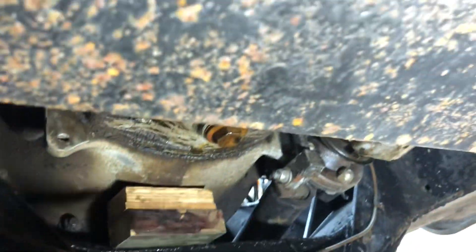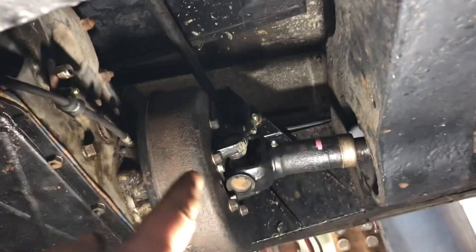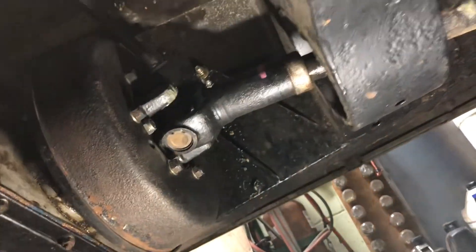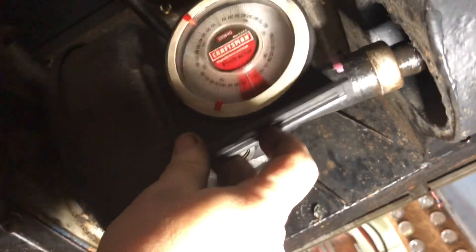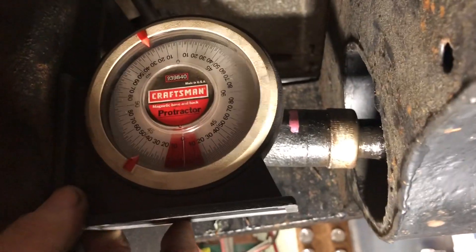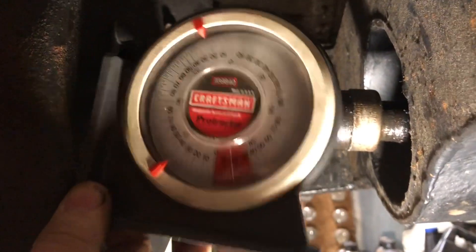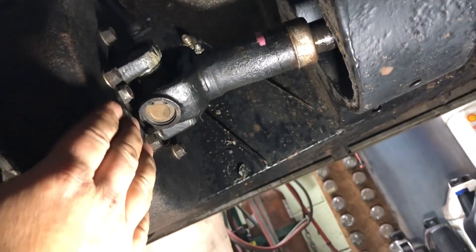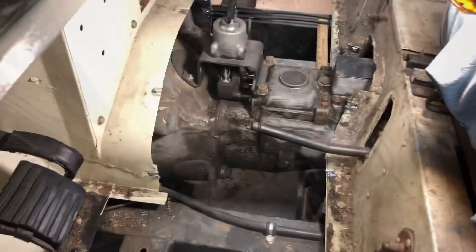Moving back here to the handbrake — I got the protractor back — when it hangs it's just about again almost half a degree toward this way, tilted a little bit. So we can get our engine in the proper position using the handbrake as a reference. That confirms the front measurement — we're at about half a degree of tilt from the engine.